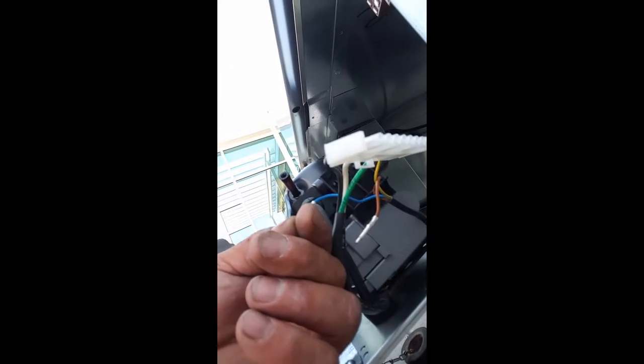With R290 there should be no open electrical fittings. With these little clips, you get something small like an allen wrench and push the old fittings out — they have little barbs on them. You open these barbs up a little bit and push them back into place, so you have no open electrical fitting. There are special wire nuts that go with them — little clamps that clip over. You cannot use a standard wire nut where you wire it together.